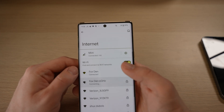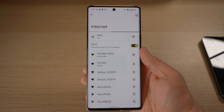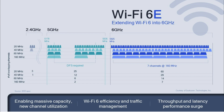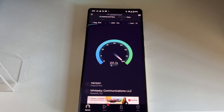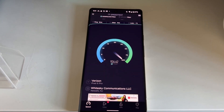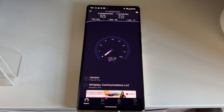Luckily, I do have one. This time I'm going to be using a Pixel 6 Pro, which has Wi-Fi 6E and is able to connect to this dedicated spectrum of bandwidth. As you can see in the settings, only devices with Wi-Fi 6E can see this portion of the network, meaning they not only get a speed boost but will face less congestion. The best analogy to describe this: Wi-Fi 5 is a two-lane highway, Wi-Fi 6 opens up two more lanes, while Wi-Fi 6E opens up three more lanes, turning a congested four-lane highway into a seven-lane speedway. Rerunning this same test on my Pixel 6 Pro, I'm basically seeing almost my entire gigabit connection being used — which has a maximum speed of 940 megabits per second, so 60 megabits per second shy of true gigabit speeds. But seriously, I have never seen a wireless device get this type of speed before — basically almost 930 megabits per second.